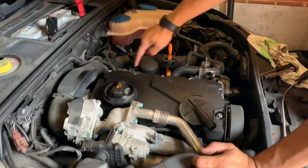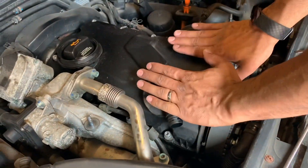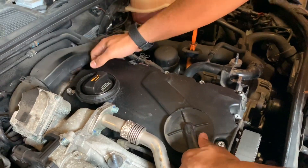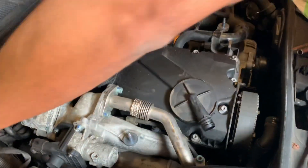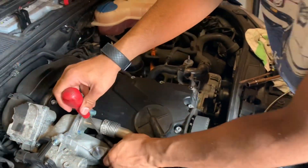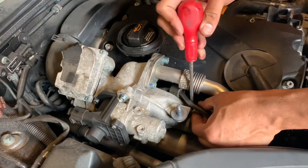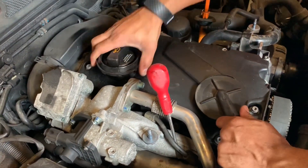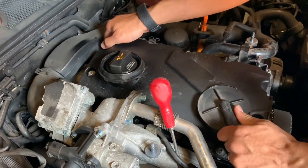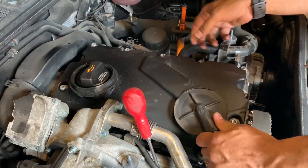We removed all the bolts and notice the cam is in this position, so you can actually take the cover out this way. Now wiggle the cover - this will get oily, so be careful. One thing I've always had an issue with is this pipe over here, so I normally just wedge a little screwdriver here to stop this pipe coming in the way. Now get the rocker cover, lift it up and wiggle it out - lift it up and then wiggle it towards the right of the vehicle, making sure all the bolts are loose.